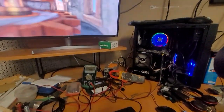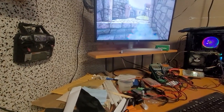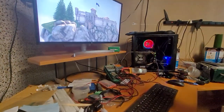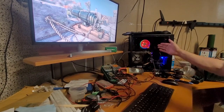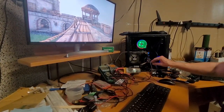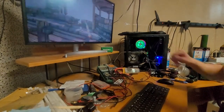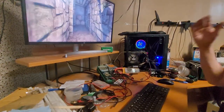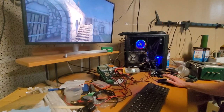Waiting for it to finish running the benchmark. But all in all, it looks like you can run a GPU with an external server power supply. So now I don't have to buy a new power supply. I can buy a smaller PSU to run the main motherboard and CPU, and now I've got 750 watts right here to run my GPU. If needed, I could parallel two of those up to give me 1400 watts. That saves me 100 bucks or so for buying a new PSU.